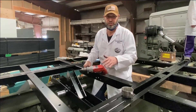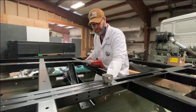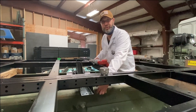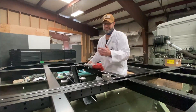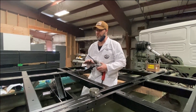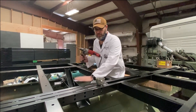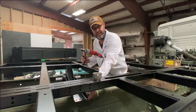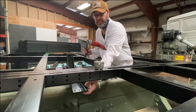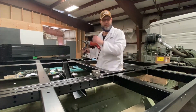With every expedition there is an expectation of ruggedness and severe duty without losing or breaking anything in the field. I'm going to use the full length of this crossmember to build a secondary gusset using these holes, connecting it to the frame — this will prevent loading on the bolts and allow the loading to be on the side of the frame, helping transfer forces and loads we can't always predict. One design feature of Globe Trekker is modularity and flexibility — giving everybody an option to tailor to fit their needs. This is designed to accommodate 40-inch-wide frames and narrower. I'm going to utilize the option to include another gusset here so I can put my loading on the side of the frame instead of just on the hardware on top.